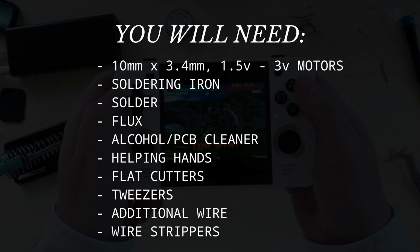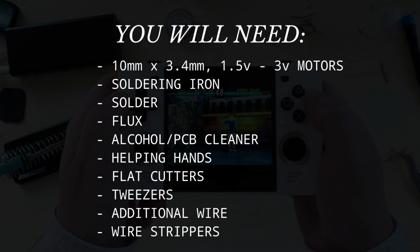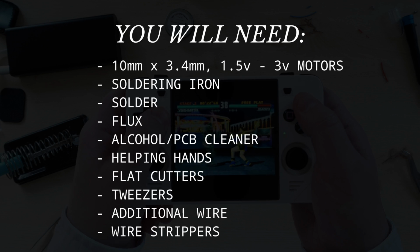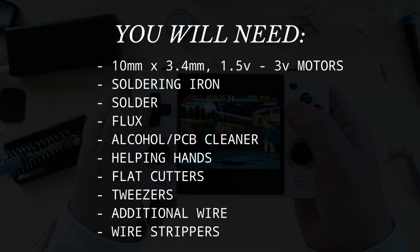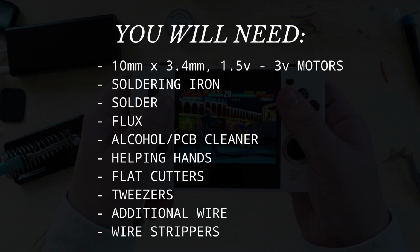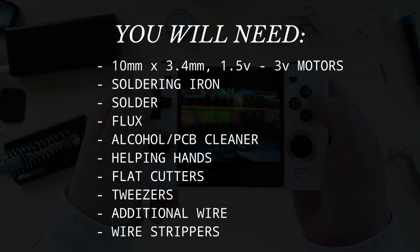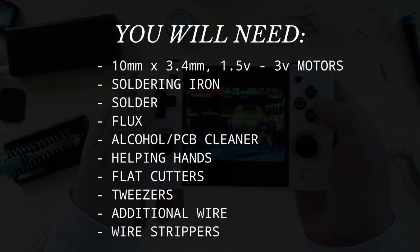So here's what you're going to need for this mod. First, the motors. You'll need to get some 10 by 3.4mm size, 1.5 volt to 3 volt DC coin button type motors. I bought a pack of 5 of these on Amazon for $4.99. I'll leave a link in the description box below for UK and US viewers in case you want to buy some. You'll then of course need a soldering iron and the associated equipment, such as solder, flux, alcohol or PCB cleaner, a set of helping hands, etc.